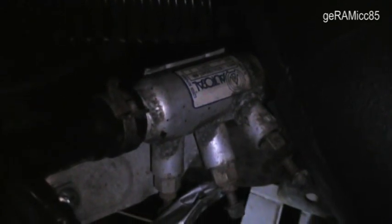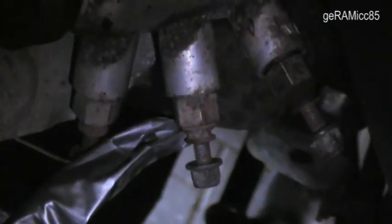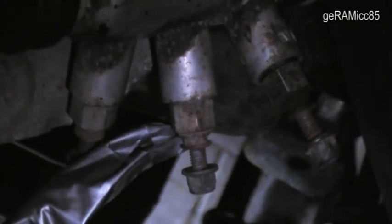To speed that whole process up, I bought a heater from the junkyard. It has three glow plugs in it. I put it right in between the engine and the evaporizer for the LPG gas. The bad thing about it, since I got it from the junkyard, the glow plugs are all dead. So I ordered some new ones and I am going to replace them today.